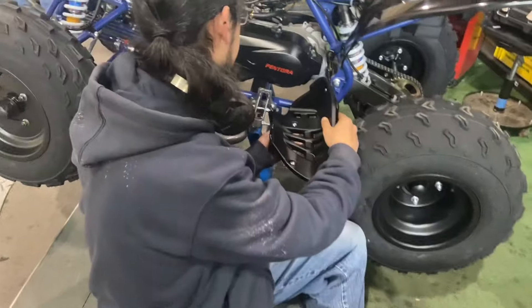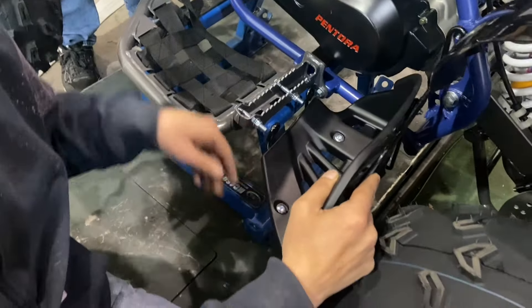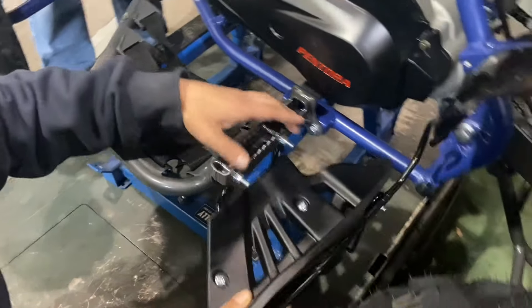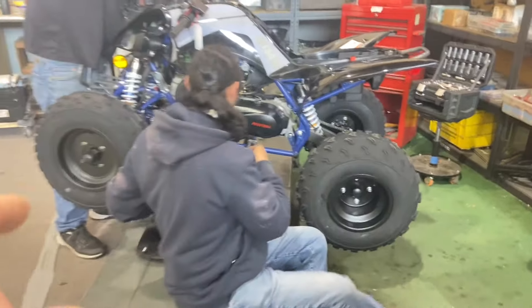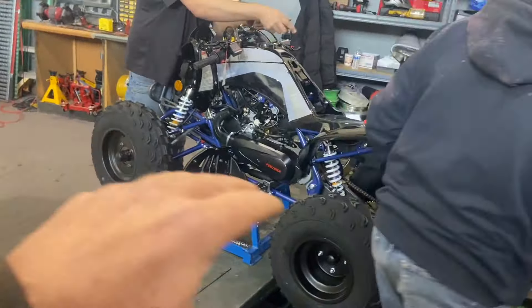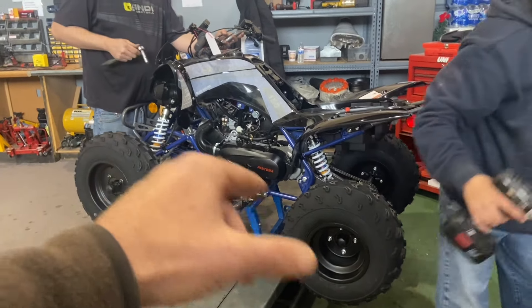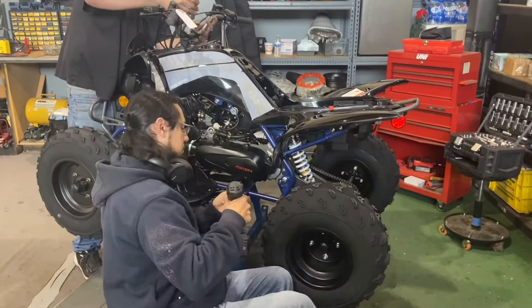Marcus is putting on the back foot rest — the heel foot guard. You're going to put a nut in there, which is a 10 millimeter. Take the nuts off so you can slide the guard on, then reinstall. It's going to take a little bit of stretching — it's not plug and play. You'll have to tighten one end, then the next end, working back and forth between the top and lower nuts.